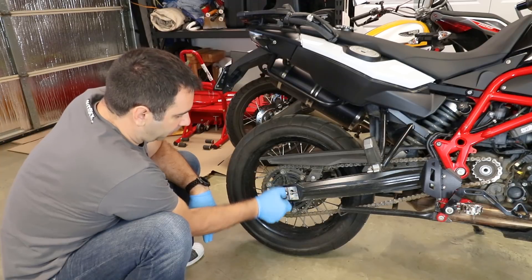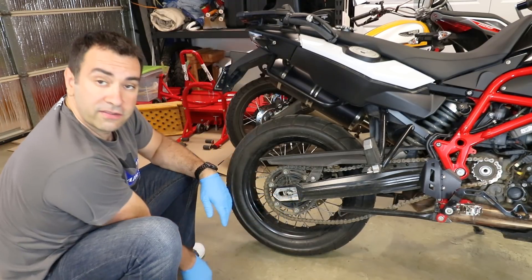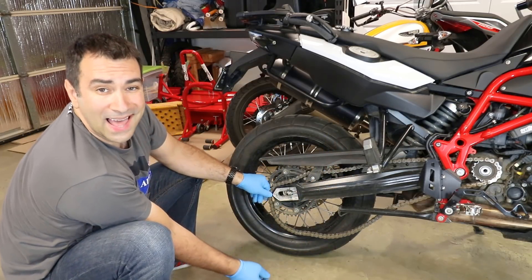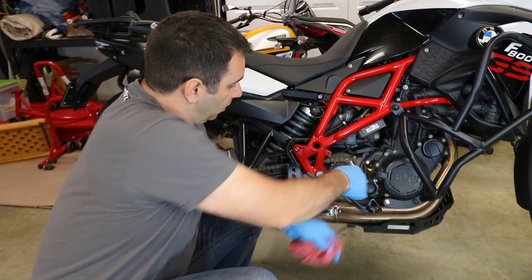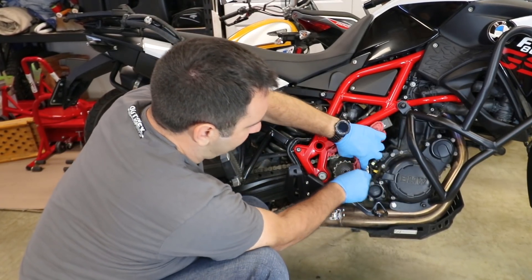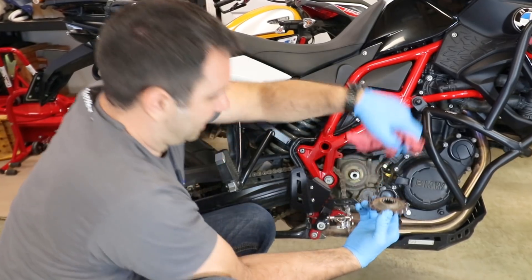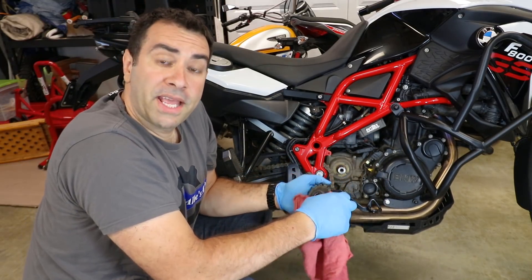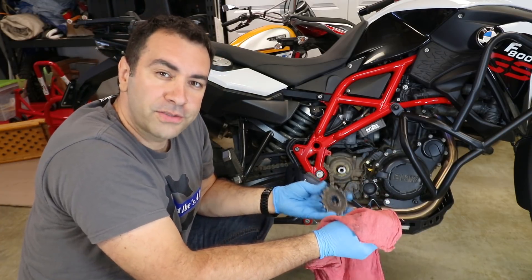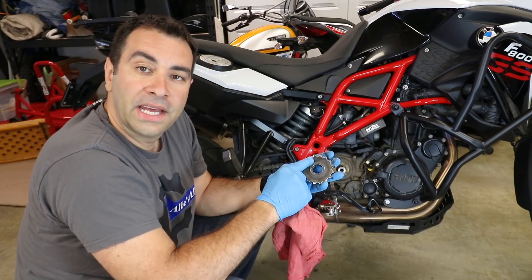To make it easy, I'm gonna remove the bolt and remove the spacer. This allows me to push the chain forward and remove it from the rear sprocket so I have plenty of slack up front. At this point the chain is loose, so it should be easy — depending on how old the bike is and how much grime is on it, it shouldn't be too hard to pull out. In my case it came out as easy as it can. If the bike is new you're certain the sprocket is a 16-tooth, but if you have a used bike you never know what the previous owner did.